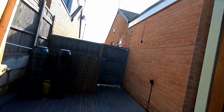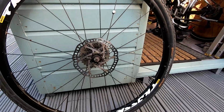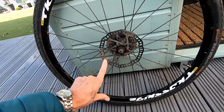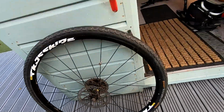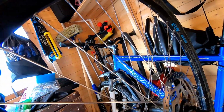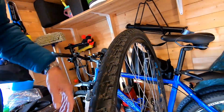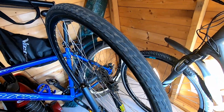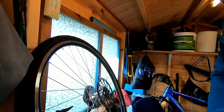See, it's different, you see. The other one, let's have a look at it. This may have come with this wheel, but that's got surface there, but space there, look. So obviously those are going to wear quicker than the outer bits, and they've worn a bit concave, but these are more all little holes all spread out, so there's not much of a problem there. But the thing is, if I had to put a new disc on this, I couldn't do it. So what would I have to do? Get another wheel. Well, I suppose when this tyre is ready for replacing, another 1,000 miles, I could try and get another wheel like this. And then they would both match it properly.